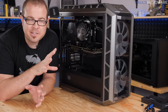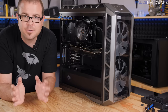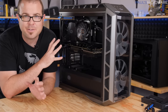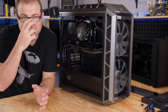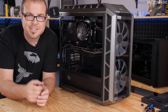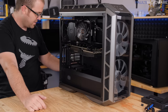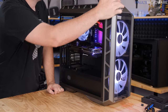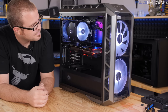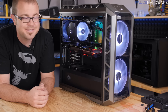The build is put together. It was a little weird because it's Mini-ITX and the power supply cable length was just barely enough to reach some locations, but overall the internal build quality is fantastic. I like the layout — there's so much room to work with that we weren't taking advantage of at all because we were shoving everything into a Mini-ITX form factor. Don't put a Mini-ITX motherboard in this case. Anyway, let's fire it up for the first time — hey, I think that's good.